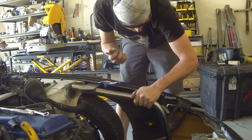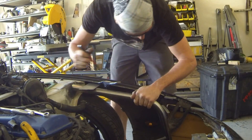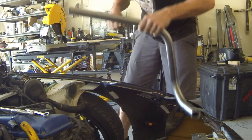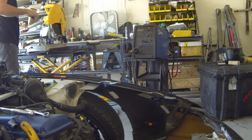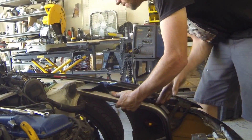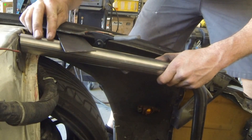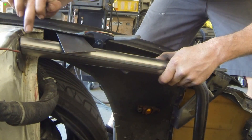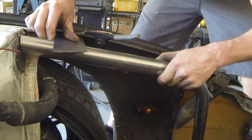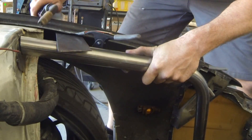I'm getting closer each time, just a little bit. I'm going to keep subtracting just about a quarter to a half inch each time — I know this needs to go about a half inch to an inch rearward on the car. I'll trim off just another half inch. I've made a couple final trims with the grinder and I've got it just about right where I want it. So I'm going to line the center of the tube up with the center reference I made earlier on the chassis and get this placed in where it needs to be. I'm pretty sure I got it right where I want — I'm going to toss in a tack weld to give myself a little bit of wiggle room.